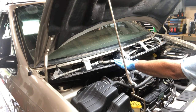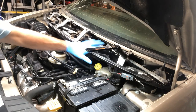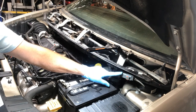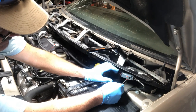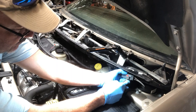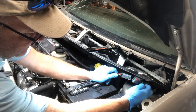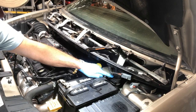You can go ahead and put in your new cowling, or if you're like me your next step is removing your wiper motor tray. That's also a pretty simple process. Step one: over here is your electrical connector with a red retaining clip. Take a screwdriver and push it up from the bottom — you'll see it pop up — then press on the gray tab to release it.